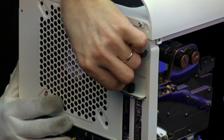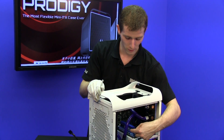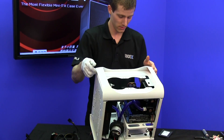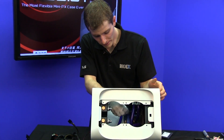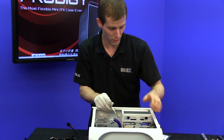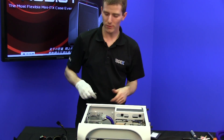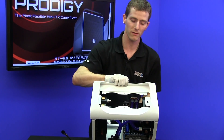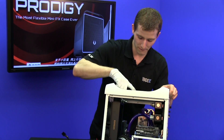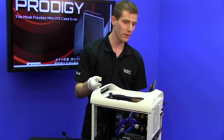Because this board is extremely well designed, most of the connectors you have to plug into it are along the edge — there's our 8-pin, there's our 24-pin, the SATA cables go right about here, front I/O goes here, and front audio goes right there. So we can access everything, but that's no reason to make things more difficult for ourselves. Some of the tubing we're going to put in will go from here to here, and finally from here to the reservoir, but they'd be in our way, so we're going to do all the other stuff first.